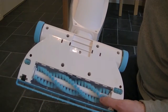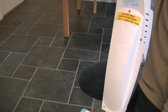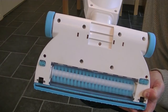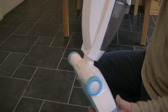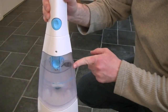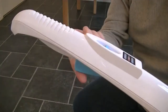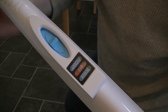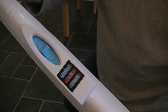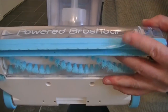Underneath here we have what looks more like a conventional brush roller that you'd find on an upright vacuum cleaner or a carpet washer. That brush bar works independent of the suction motor, and that's important — you'll see why in a minute. Basically, what you do with this machine: you fill the top tank with detergent and warm water, dispense the solution onto the floor using the trigger, and switch to scrub mode. Then you scrub the solution onto the hard floor. When you've done a section, you switch to pick-up mode and the suction removes the dirty solution into the dirty water tank via the squeegee at the front.